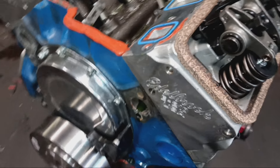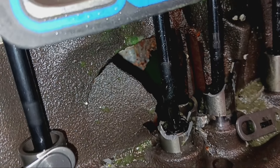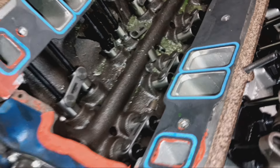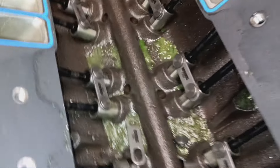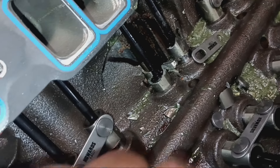This right here is what you call blow-through. We can see into the neighbor's house — it's busted. Cylinder four, cylinder six, probably cylinder one. Cylinders one, four, and six are busted just from looking inside the intake valley. I haven't removed the head yet — hopefully the head is not messed up. We have two lifters that are completely destroyed. The link bar is gone and the lifter is damaged.